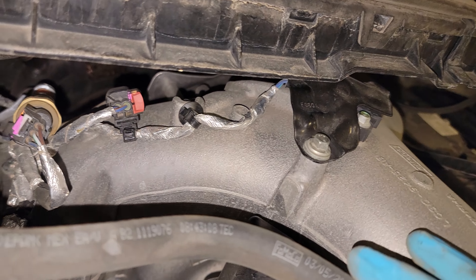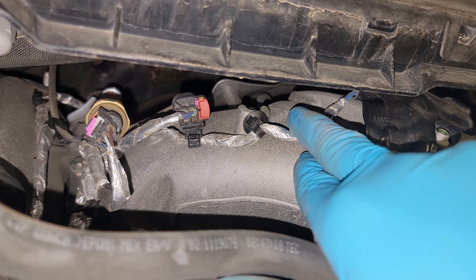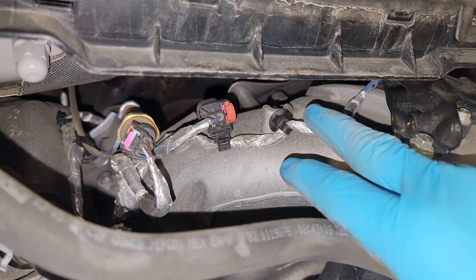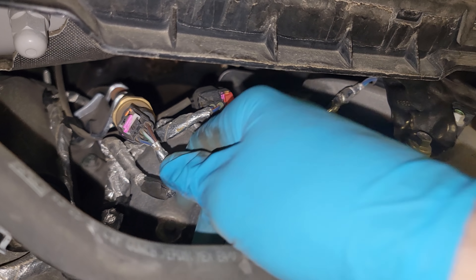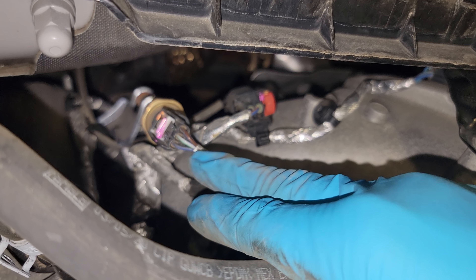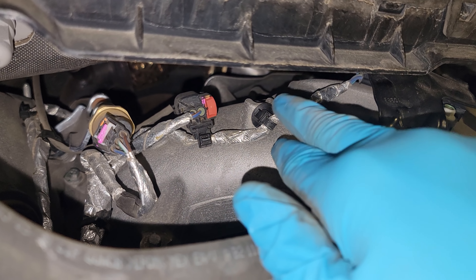Anything above 14.7 is going to indicate pressure. Although both sensors were reading PSI, they were just not reading the correct PSI for the given application — this one is supposed to be increasing at a different rate than this one, and the PCM knows that. Make sure to plug in the correct sensor. All the MAP sensors are blue; the MAP sensor has a tether and the EBP does not. Obviously you need to run the tethered wire right in front there.